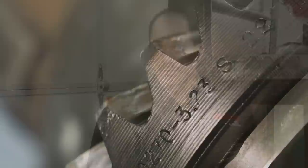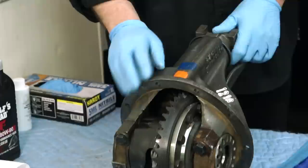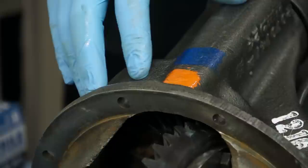Our 741 case is set up with a 3.23 gear ratio. It is a Sure Grip unit and the ring gear has 3.23 stamped into it to identify the gear ratio. For assembly purposes, back in the day assembly line workers used to put paint dabs on the outside of the carrier. There were different color configurations to determine what gear ratio and flange size was used. The blue paint dab stands for 3.23 gear ratio and the orange paint dab stands for a Sure Grip rear end.